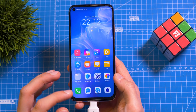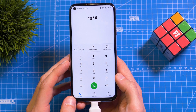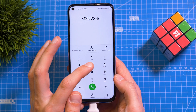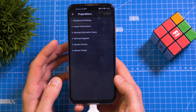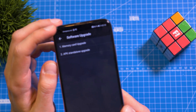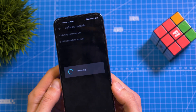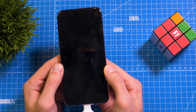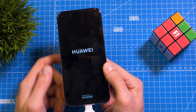Once the dload folder is on your USB drive, open up the dialer and put in this number: *#*#2846579#*#*. Now you're in the secret Huawei menu. Go to Software Upgrade and choose Memory Card Upgrade. If you hit the OK button, your phone will automatically reboot — but don't be scared. It's rebooting into the recovery and it will start the installation from the dload folder on your USB drive.